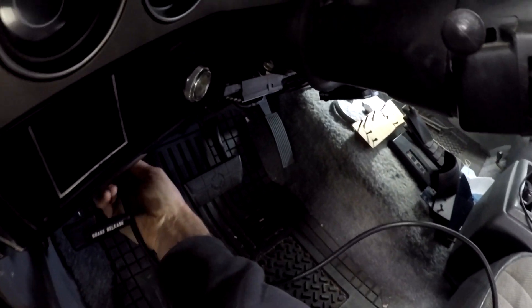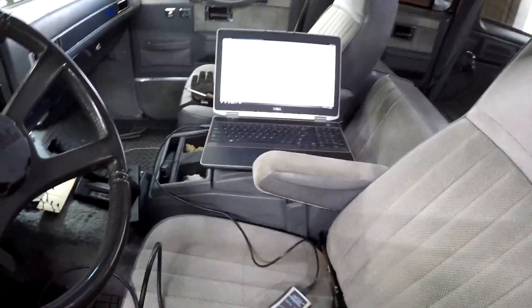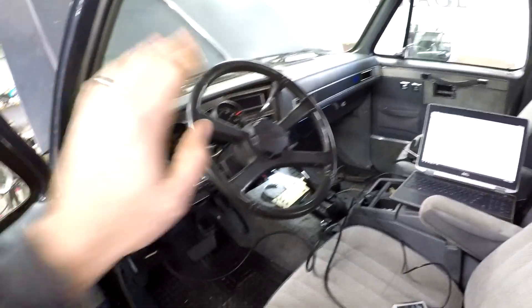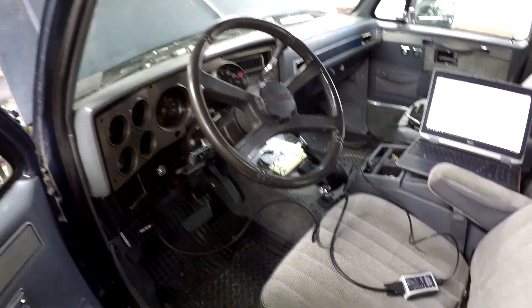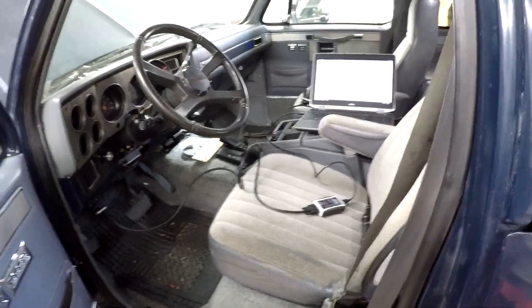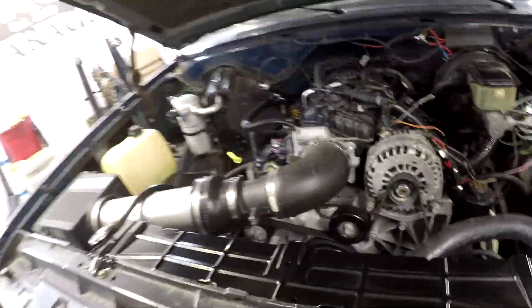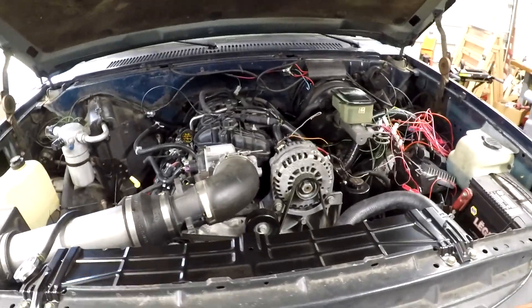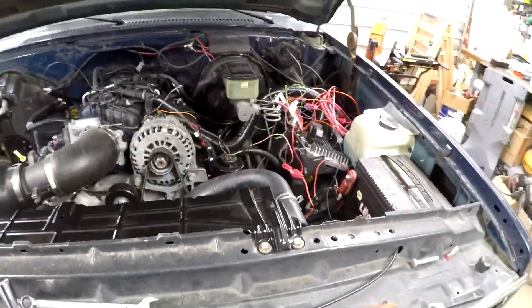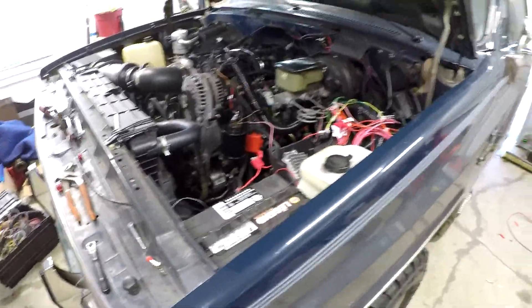What I'm going to do right now is flash the computer one more time to see if I can get the tach working. I also removed some more DTCs — I missed a couple of the rear O2s that popped up, and there was another one that was set on second fault that didn't trigger the first time around. So I'm just going to keep record of when they pop up and turn them off. Each time I upload a calibration I'll knock more of them out, and I think I'm getting pretty close.